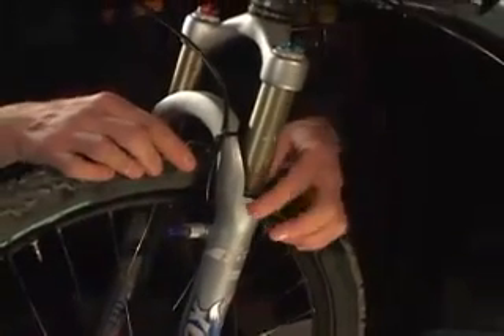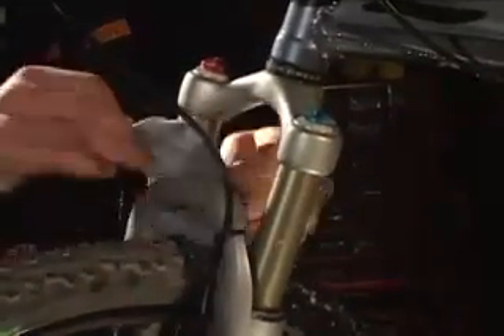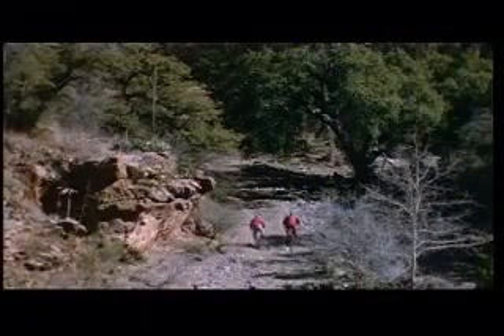You make it easier for the dust wiper to do its job by keeping it clean. With almost any modern fork, the foam ring is a common element, and if you hang the bike upside down to store it, you get a lot better longevity and the fork works better. After every ride, keep everything clean from the top, dry it off, and get in around behind the fork brace and clean in there. If you see oil flowing down the outside of the fork on a regular basis, or getting out onto your rotor, both those things indicate a real need for service.